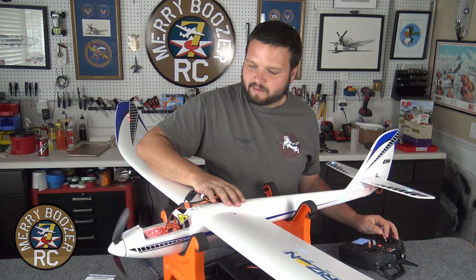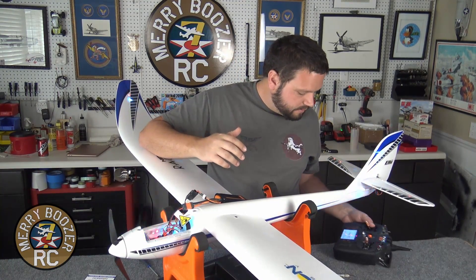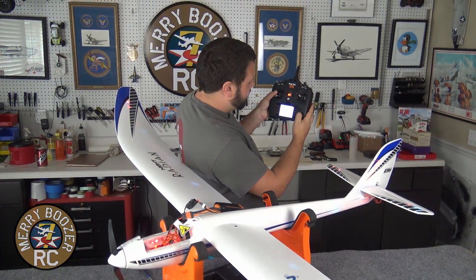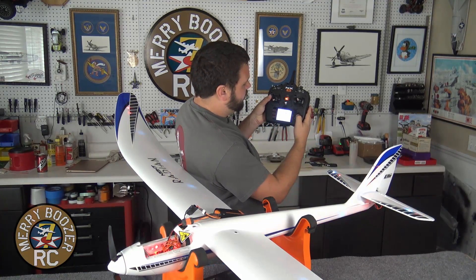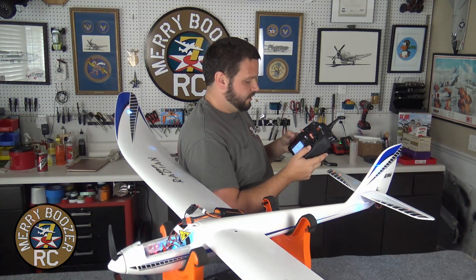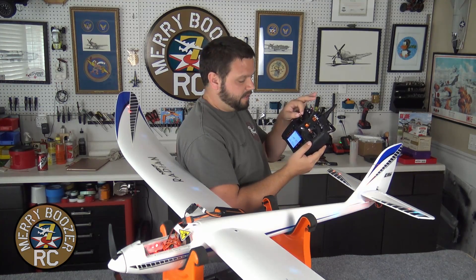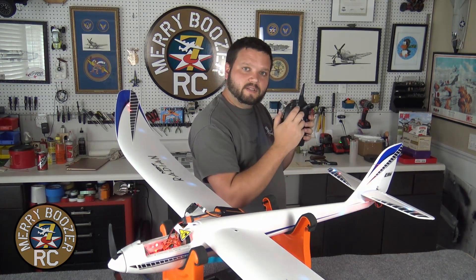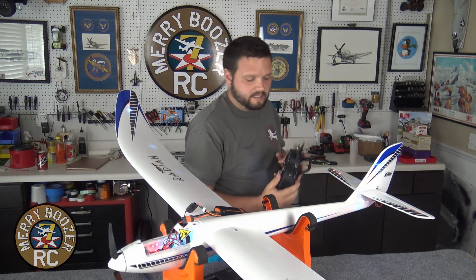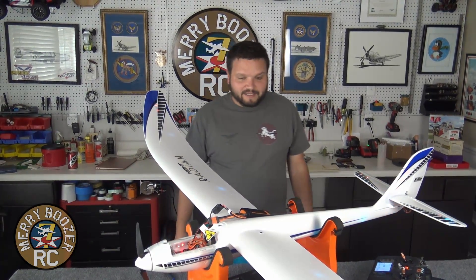That's it for the lights. There's 10 billion different color options to choose from. The motor works — you can see the throttle has a brake on it. The other setting we should add into the transmitter right now is throttle cut. Click the scroll wheel down, go to throttle cut, flip the switch — now we have a throttle cut on switch H. As you can see, the throttle is now deactivated, so if we're working on the bench and accidentally hit the throttle, this switch being activated means we won't hurt ourselves. Throttle cut's always a great idea.